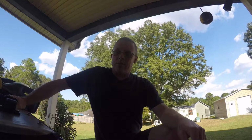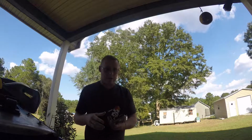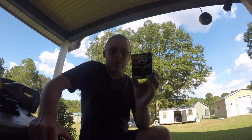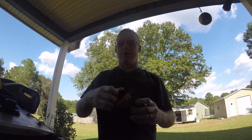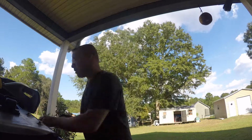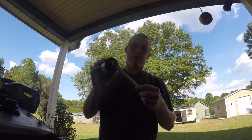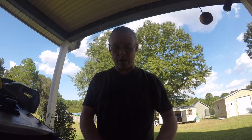So what I use is I cross-reference the number. This is what I use. It's a K&N filter. Costs more than a Yamaha filter. It's a KN303, if y'all can see that. This is the filter I use. And what I like about these filters is all you need to get it off is a 17 millimeter wrench, because these K&N filters have a wrench nut on the back, so you can put a wrench on it. Easy off, easy on, no fuss, no muss.